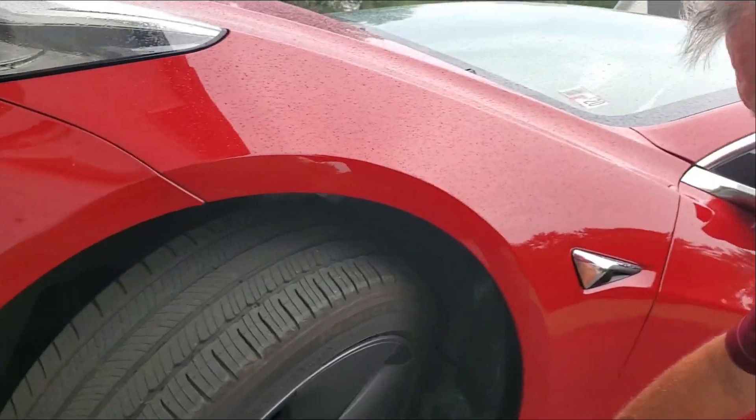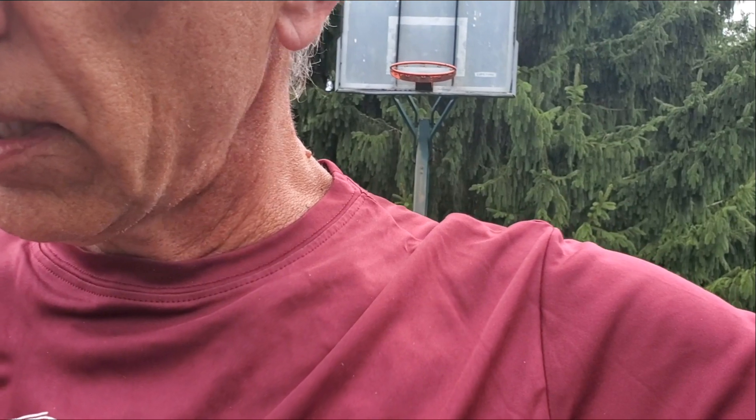I think that's pretty neat — got mud guards on my Model 3. I'd definitely give this a thumbs up. I think it'll definitely help keep the bottom of the car cleaner. They look great. Relatively easy to install — needed a screwdriver, both a Phillips and a flat screwdriver to pop off the old clips, and a regular screwdriver for the one screw. And then a ratchet — I think it was 10mm. Let me just double check. Yeah, a 10mm ratchet to get that bolt off. You could probably use pliers too to take that bolt off that mounts on the rear.